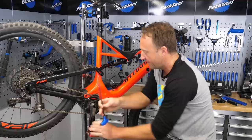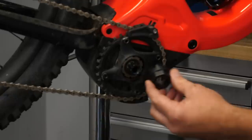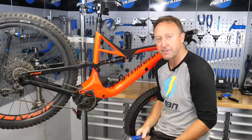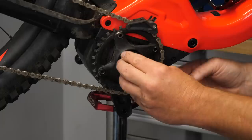Don't be too concerned if it's a little bit stiff. Remember, it's just the drive-side crank you're taking off — it's worth leaving the non-drive-side crank on to help you get purchase when taking that spider off. Next up, castle nut remover and an adjustable spanner, or a 32 mil spanner — my favorite tools in the box. Simply slot that on and drop the spanner; the non-drive-side crank is there to help you loosen that castle nut.